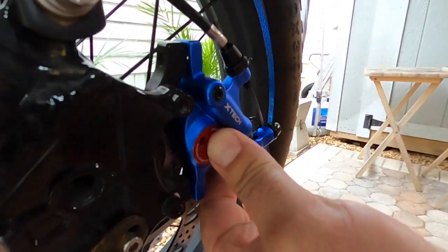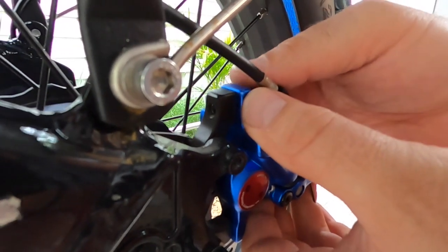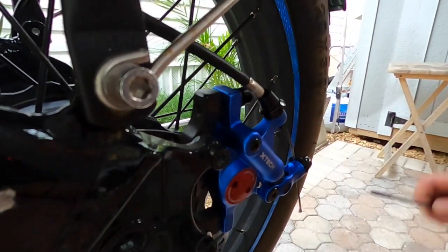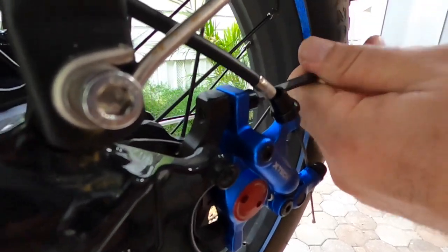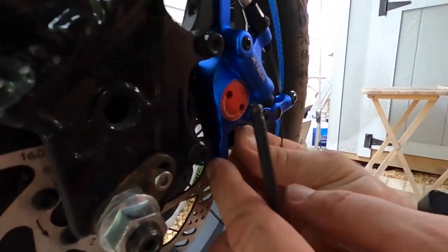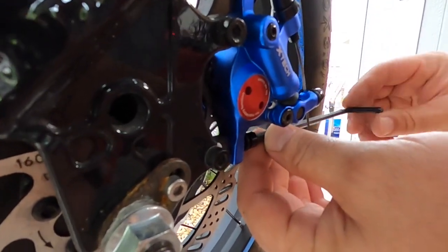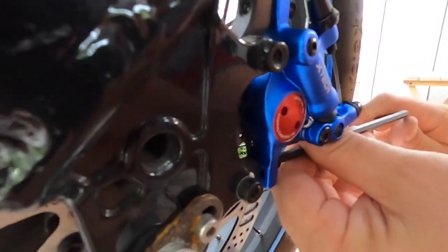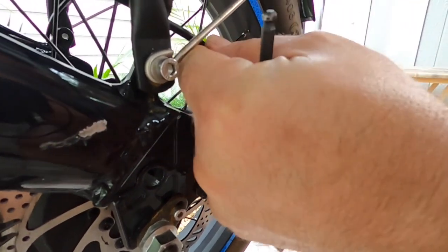Feed the cable into the caliper and up to the bracket. Now it's important on these that you don't strip the screws, and it's going to feel a little awkward because it has the thread sealant on it — so it's like, did I cross-thread it, or is it the thread sealant? This is where experience does come into play, but this is not beyond the capabilities of a novice user or first-time installer. It's intended to be a little tight so that the screws don't back out. Generally you can feel your first three or four turns move freely and then you move into the thread sealant, and at that point you should have a good catch.